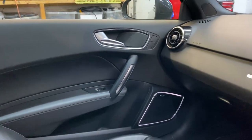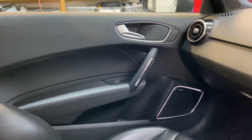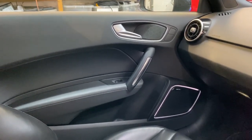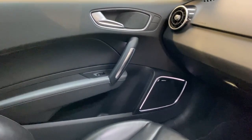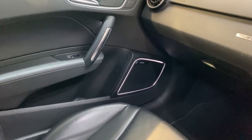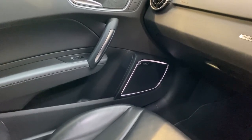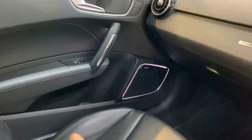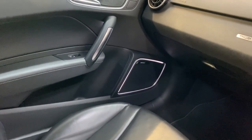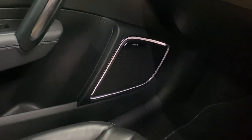The two-way Audison Voce speakers are a million miles away from the three-way Bose speakers installed in here, which won't be made by Bose anyway. We've done our usual three-layer soundproofing system — stripped the door right down, soundproofed the whole back of the door card, the whole inner skin, and the regulator panel. We then created strong baffles at the bottom, machine-screwed into the original door nut and bolted in. The Voce speaker is attached to that with a custom gasket seal against the back of the door, and we've retained the little feature light around the speaker.